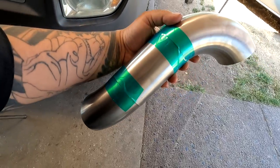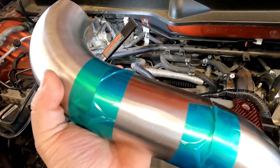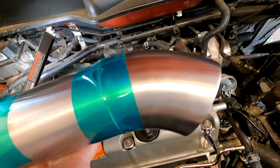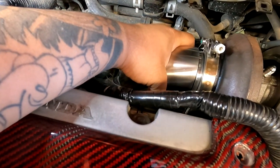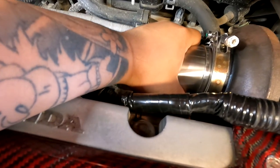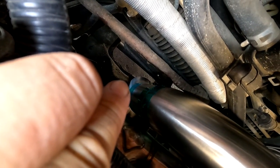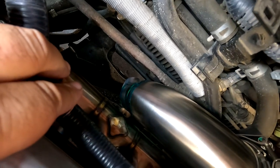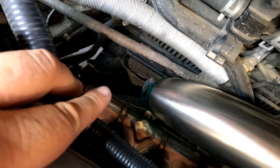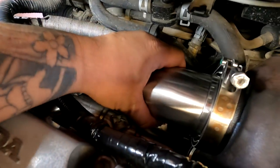I was test fitting some piping I had lying around before getting into the actual cutting to get the angles I need. With the long 90, a short six-inch straight, and a 45 taped together, this is pretty much going to make the top half of the downpipe. I'm not making this downpipe two-piece, which is typically how K-series are done, because there's a lot of room down there to snake a whole downpipe through. It's literally pointing backwards and towards the floor, so it looks like all I need is a straight and a 45 to point it backward. I might put the flex bellow somewhere before exiting past the subframe.